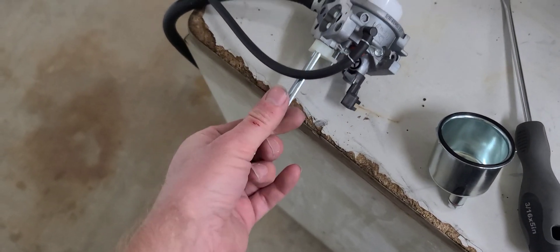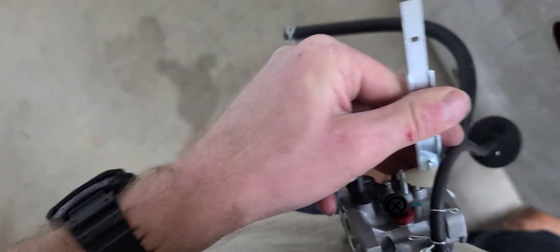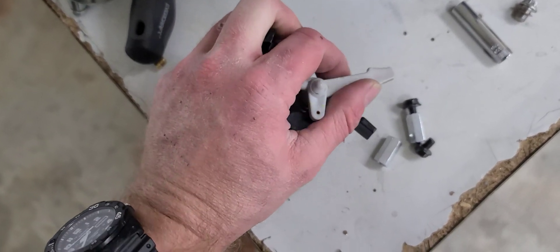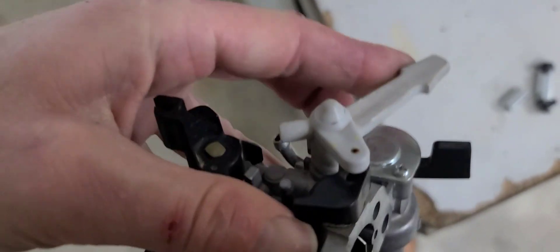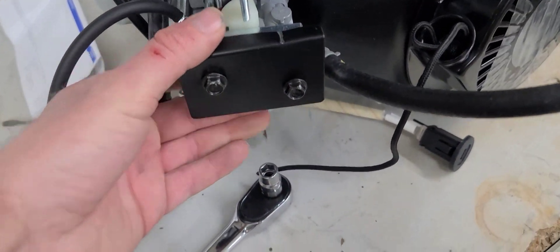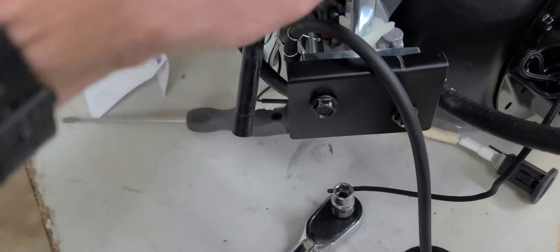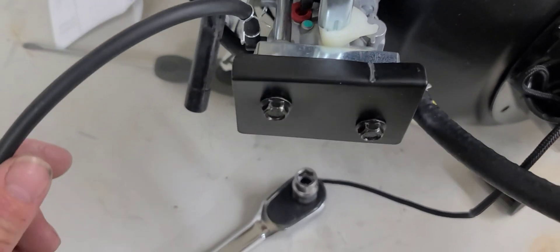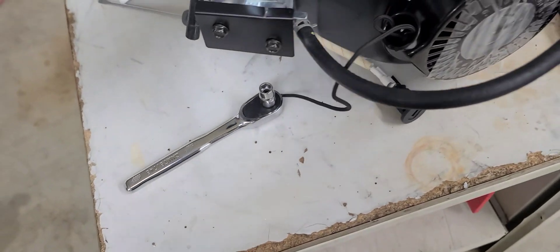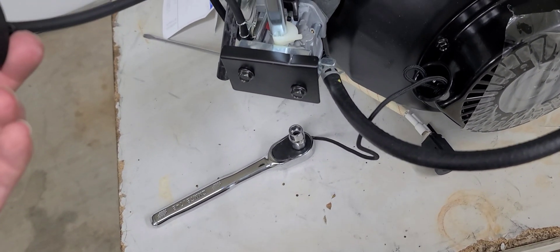On the Storm, the choke doesn't fall off, so when you go to put the cone air filter you don't have to worry about that choke holder. Versus on the other carburetor, you have to put that choke holder on top — otherwise this guy falls right off. In its stock configuration it just has an air block on there, so it's getting full airflow to the carburetor. If you bolt on one of the cone air filter adapters, you won't need to change jets because it's already jetted for pure air and not going through a filter.